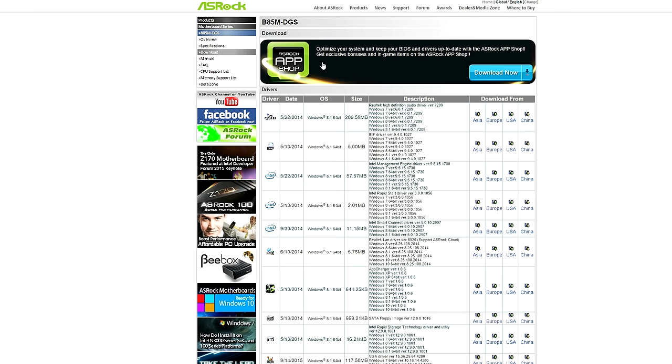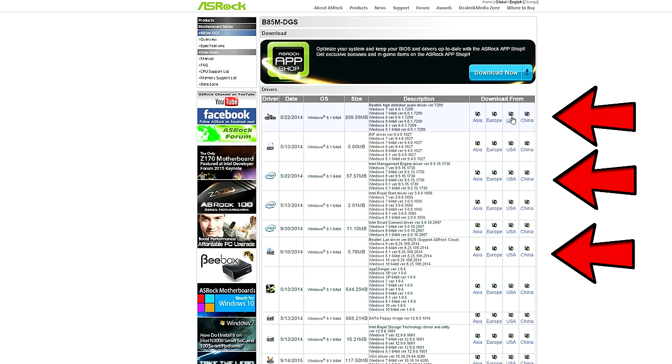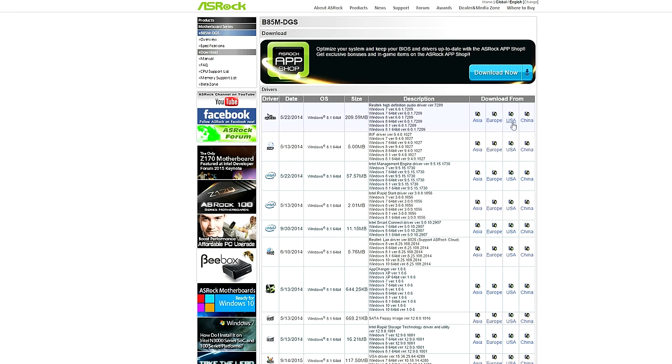Next, you will need to visit the ASRock website and download the motherboard chipset drivers, and I'll go ahead and leave a link to it down below. So you will need to download the audio driver, Intel driver, and the LAN driver. Once they are downloaded, make sure to install them.